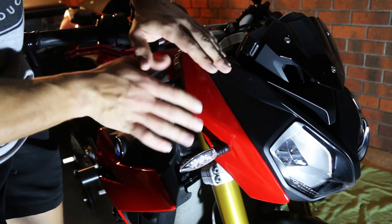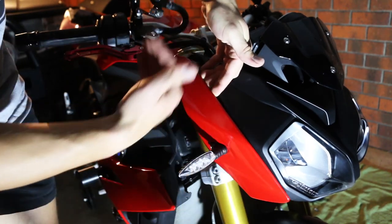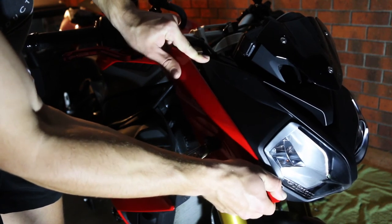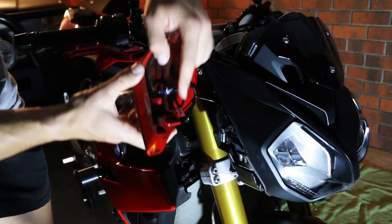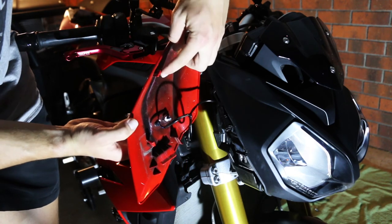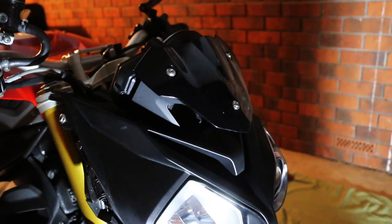It's a very unpleasant click — I don't know why they use plastic clips, it's fucking stupid. It's an easy way to get things broken. After that's fully released, this fairing is going to go upwards — be careful you don't smash your fairing. There's some metalwork here so it's important to protect it as you work it off the frame, just rocking it backwards and forwards. This clip actually faces downwards and hooks around there — I don't know why they make it out of plastic, it's useless.